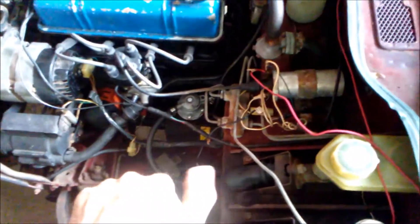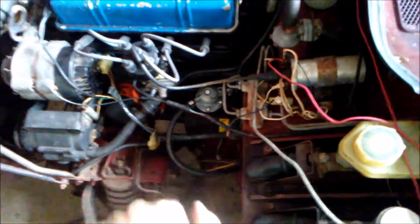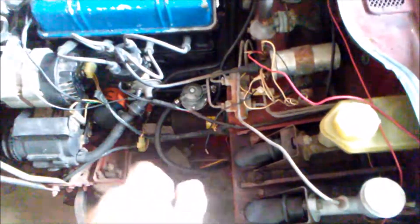I was sitting here trying to crank it and it just would not start. So I unhooked the fuel line from the main gas line and, with one arm reaching in cranking the key over, I checked the hose for pressure or suction — it was getting none. The pump was not sucking like it's supposed to.